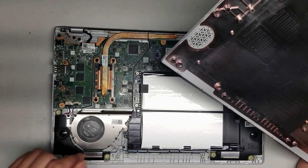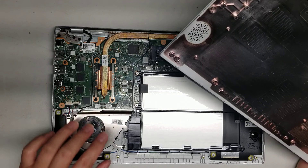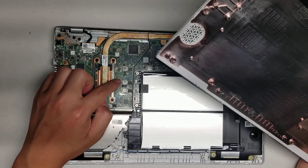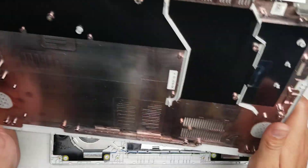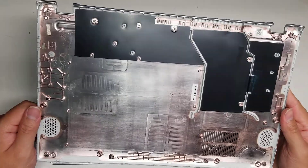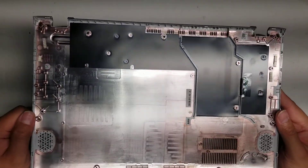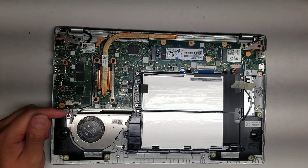This actually has a motherboard issue, so I'm thinking it's due to that design. The air probably pulled in the dust, there were probably some conductive dust particles, and it probably screwed up some components. I'm probably thinking it's not going to be worth repairing because of this bad design flaw, but I'll let the customer decide.